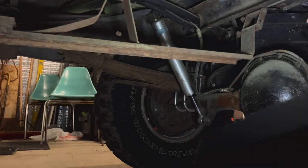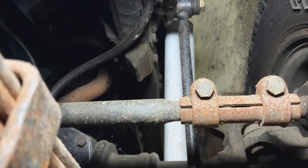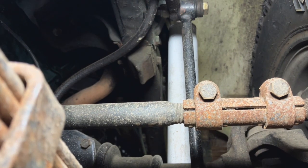The shocks on it were parts-pile shocks I had lying around. The front sway bar end links are from the rear of a WJ '99 through '04 Grand Cherokee. Going into the steering — I replaced the steering box about three times. All of the parts-house boxes were just junk out of the box; they wouldn't bleed. One of them didn't have turning to the left, one of them wouldn't turn at all. Finally the third one, after bleeding, worked out great.